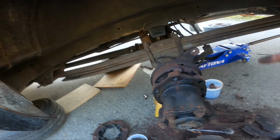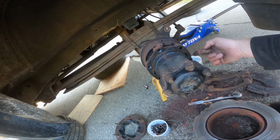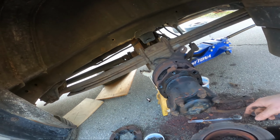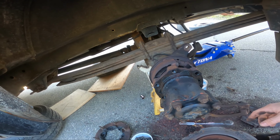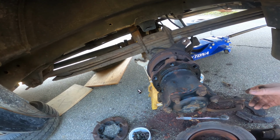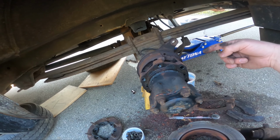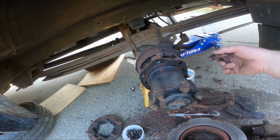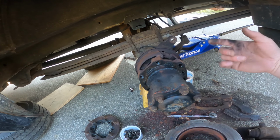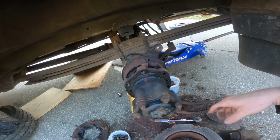Almost everything's out. I got new rubber lines on the way, so I'm gonna peel those off, see if I can gut this parking brake, and then put new parts on, leave the wheels off, so that, well, I can get those lines on and bleed them with the wheels on. I did it before. So I'm gonna put the wheels all the way on, just kind of test, see if I feel like I can reach it well enough to assemble it and bleed it tomorrow.